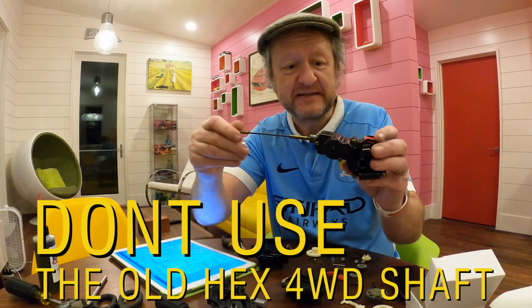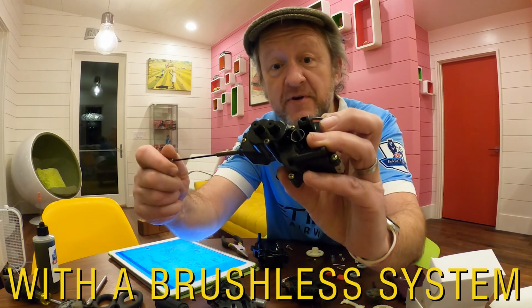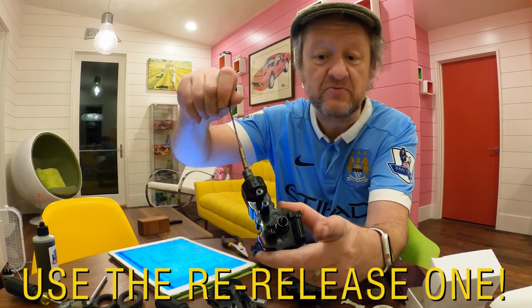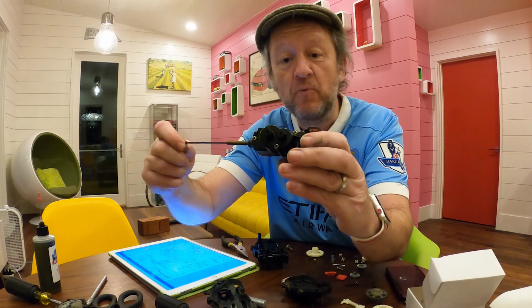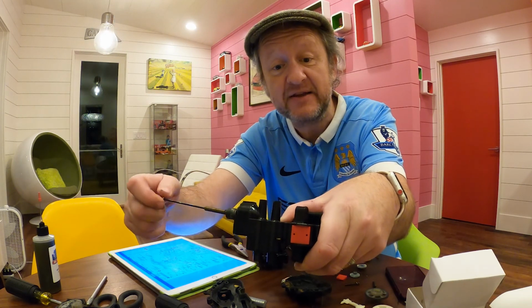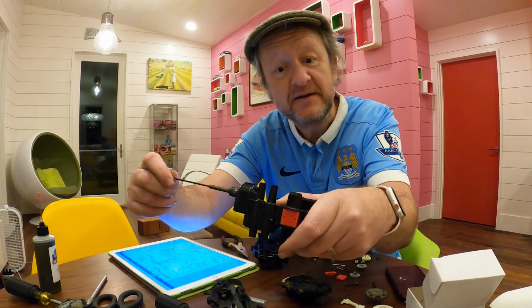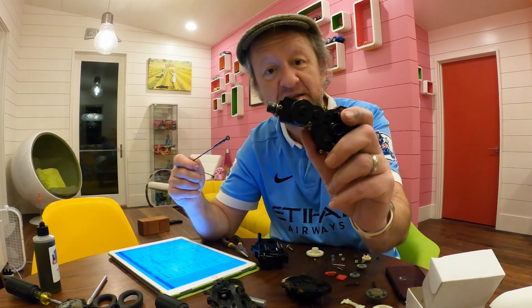Now when you twist it, do you see these axles rotating right there? Those should rotate, okay? And the same one on the other side should rotate at the same rate. Now, if you put your finger on one like this and hold it in place, the other one should still rotate until it kind of stops, where it's hard to go any further. That's called a slip differential. So that's the slip differential system of this transmission.